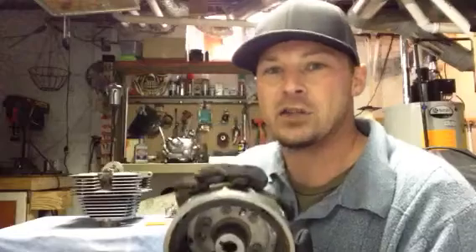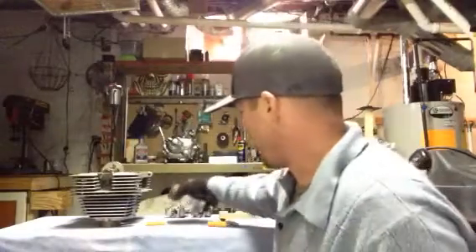On the Rebels, this is fixed timing. So you really want to degree your cam rather than worry about advancing your ignition timing. If you have a stock CDI and you advance your cam, that will affect things because you have a limiter on your firing. Advance your timing with your cam and the stock CDI ignition, and at higher RPMs it's not going to fire well.